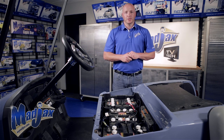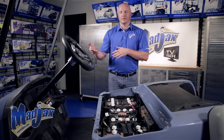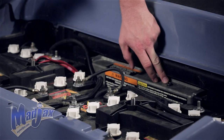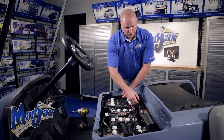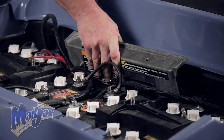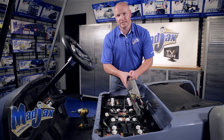Now we're ready to install our controller. You may need to remove the middle two batteries to make it a little easier to get the controller box out of the cart. Make sure none of the harnesses are in your way. Pull the harness box down and straight out. Also lay a piece of cardboard down so that you don't touch any of the contacts.